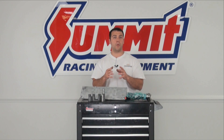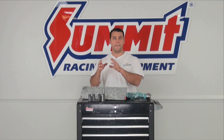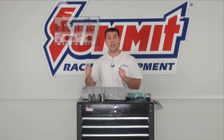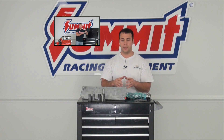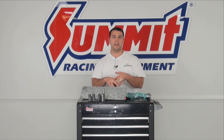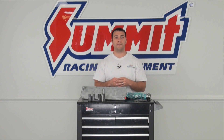After you've completed your camshaft swap, you're going to want to make sure the springs in the cylinder head match the camshaft's lift with no bind, as well as verifying the pushrod length. We've done a video on checking your pushrod length — you can watch that here. For variable valve timing, we also have a delete kit that includes a timing cover and a new cam sprocket, getting you on your way so you can select the appropriate lifters and camshaft for your build.